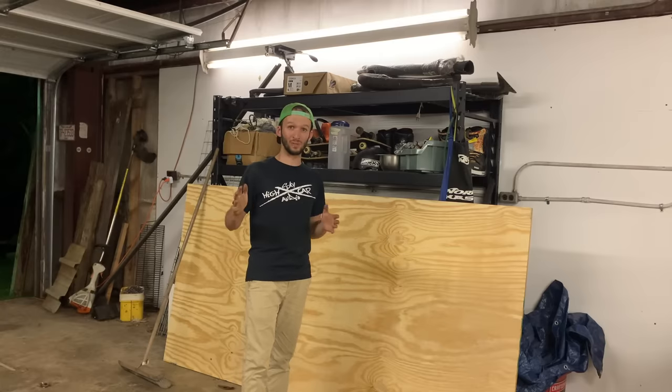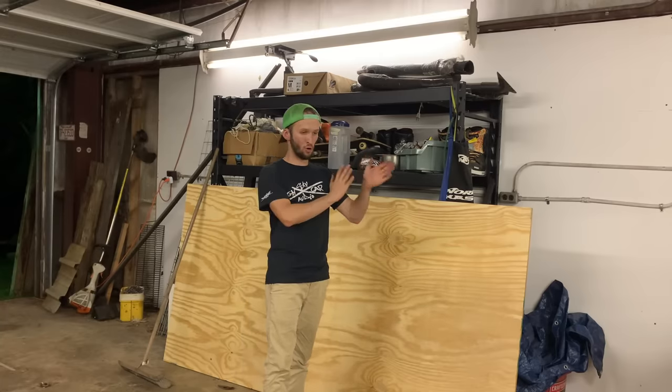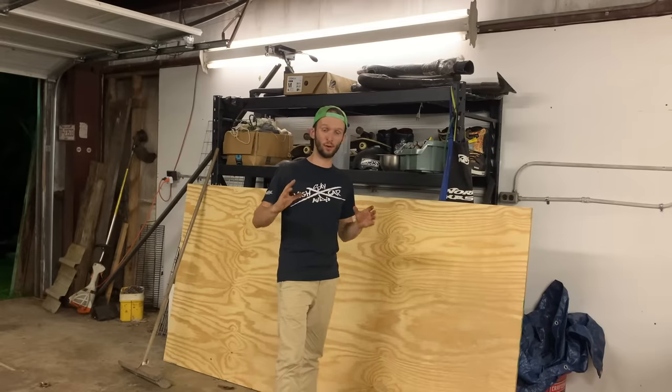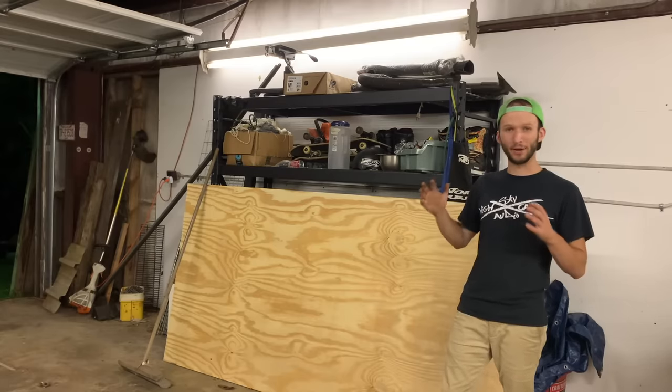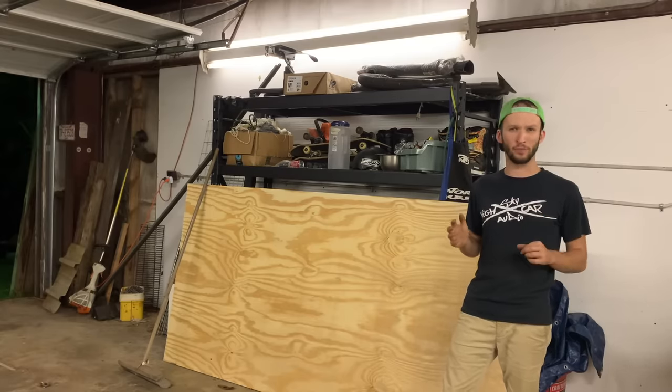Now, first thing we're gonna do is be building the box. It's gonna be a super simple design. We're gonna have all the subs lined up on top in a line, firing up. We're gonna have 2 8-inch aero ports on the side. Now for these specs, it's gonna be right around 8 cubic feet total, tuned to, I believe, 34, 35 hertz.